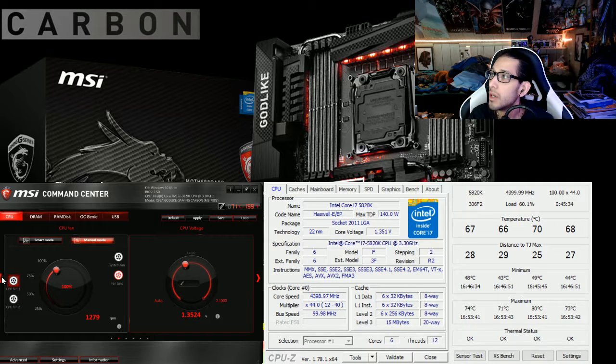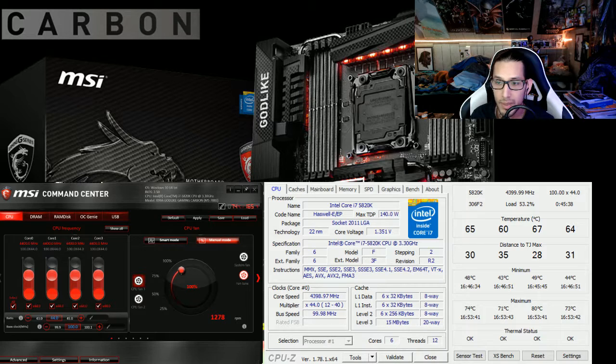I'm pretty confident that at 1.3524V it's okay. I haven't tried going beyond 4.4GHz — I believe I could probably hit 4.5 or 4.6 if I bumped it up and went to maybe 1.4 volts. But this is just a quick way to get your overclock done in less than five minutes and have it be stable. I'll list all my system specs in the description box. I ran a test in IntelBurnTest 64 and it's been stable — I've had the board exactly one week and I'm already in love.